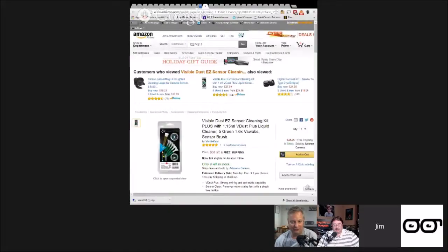And is this the same deal? Yeah. Well, this probably should have come after the air rocket. This was actually what I needed to use to clean my actual sensor, which I never wanted to do, was touch my sensor, because that is the most important part of your camera. I had to actually go in there and clean the sensor with this. I went over the sensor twice, took pictures, and my sensor was absolutely clean after that. Versus sending it in for repairs, because otherwise you almost have to send it in, and it's going to cost you probably a minimum of $100 to have your sensor cleaned.